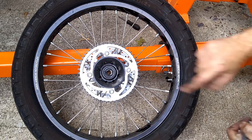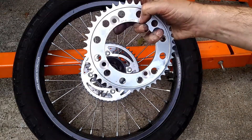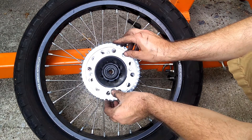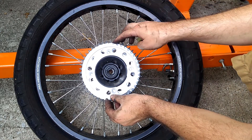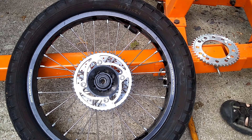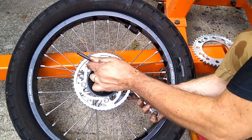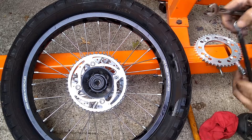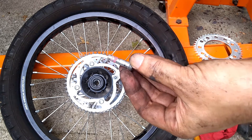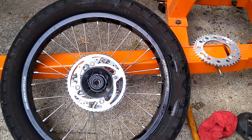Here's the stock factory 47-tooth sprocket — you can see it's got a 47 stamped right on it. Here's the replacement I'm going to use, it's a 43-tooth. First thing you do: make sure you've got the right one before you start taking things apart — line up the mounting holes and I'm good to go. Now removing these bolts, you're going to need a 10 millimeter Allen wrench for the front, but on the back side of each one there's a nut that you're going to need a 12 millimeter wrench for. Notice the pink on there — that's red Loctite thread locker. You're going to want to use Loctite to put them back together to prevent them from coming apart, even though they used a nylock nut here. Just for safety, thread lock it.